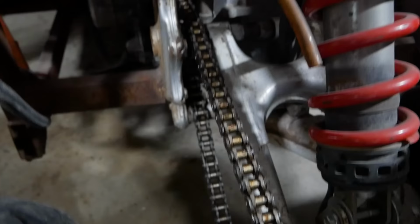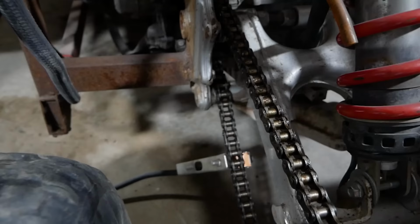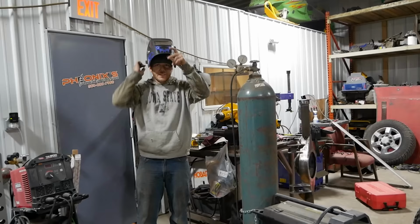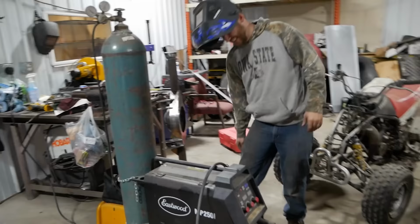Unfortunately, this master link, this was an endless chain, and the old chain was a link chain. Yeah, you can already see what we're doing. The master link doesn't protrude far enough to get the clip in. So we're just gonna tack that cover onto those pins and we'll have a chain, which means we'll be ready to rip this thing around for the first time, hopefully running correctly and geared correctly. All right, I'll go get the gasoline soaked rag. All right.